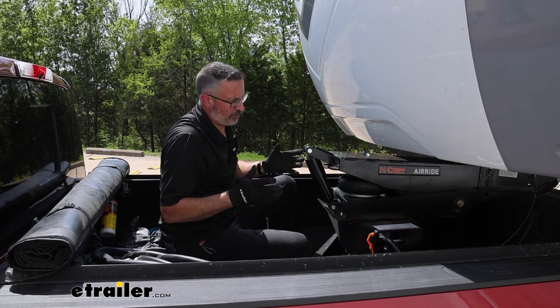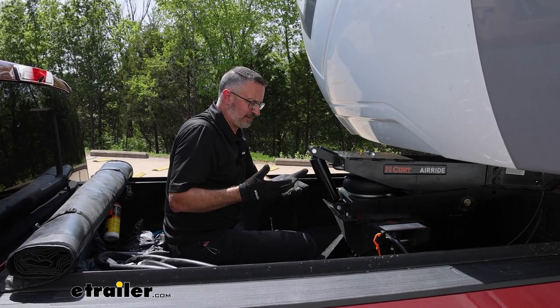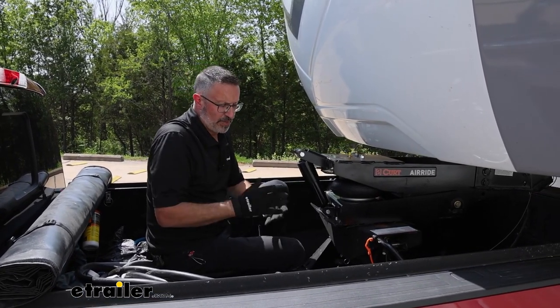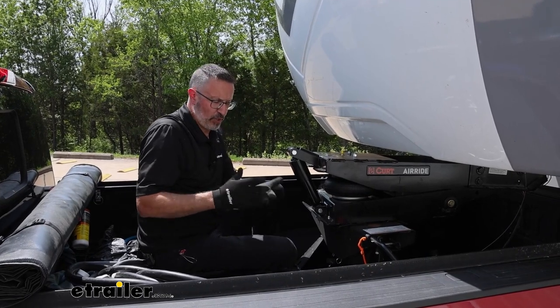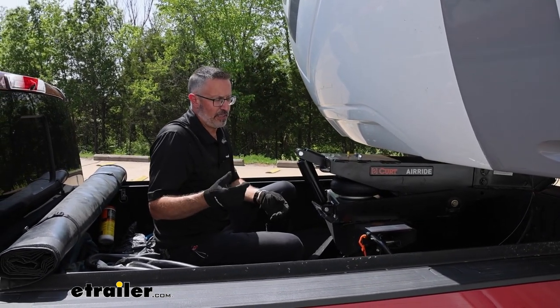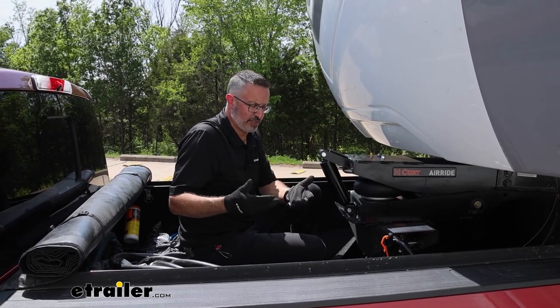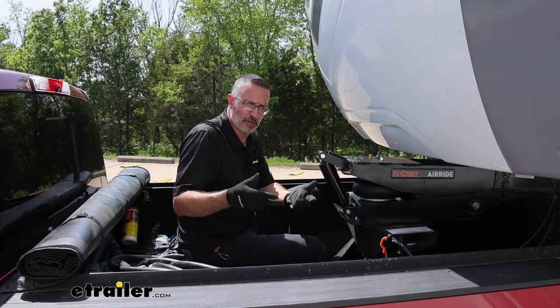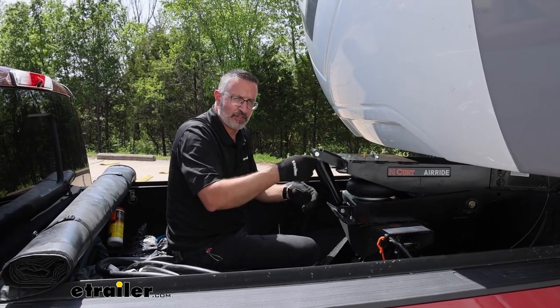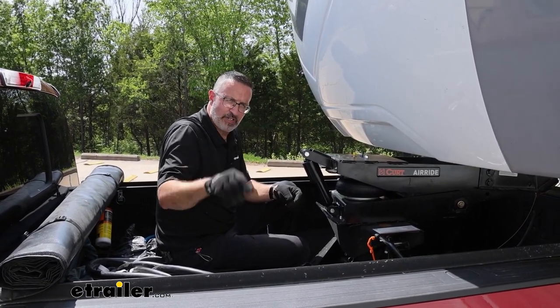As far as installation goes on this pin box, things you need to know that are quite obvious, it's heavy. So in the past, we've used forklifts. We've used a bunch of people to lift it up. On this install, we went a little bit different. If you have a pickup truck, if you have a floor jack, check it out. It wasn't too bad. If you're good at unbolting bolts, there's 10 of them. You can get it installed. We'll show you right now.